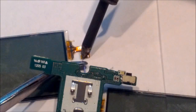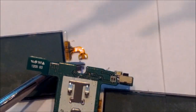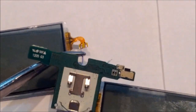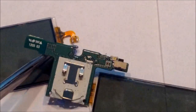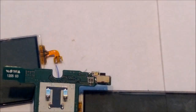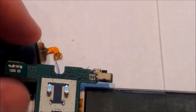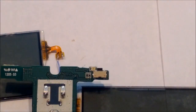So once you solder the one to the connector, you can go ahead and grab the other one and solder it. You'll notice that I took those wires and I put them facing the circuit board or running across the circuit board. I do this so that they're not sticking down on the nose piece. Makes it a little easier for me. It just kind of puts the wires facing in the right direction to begin with, so that they're all laying across the circuit board at the end of the build and not sticking out of the frame anywhere.